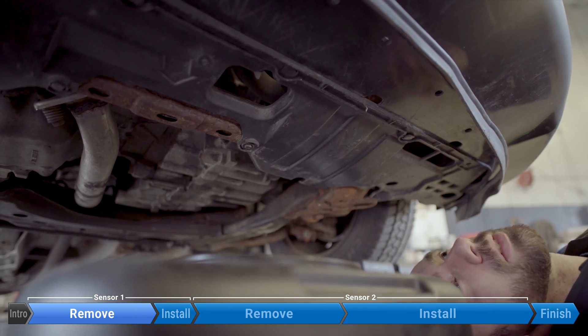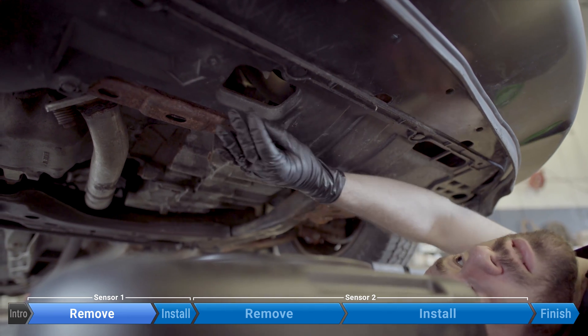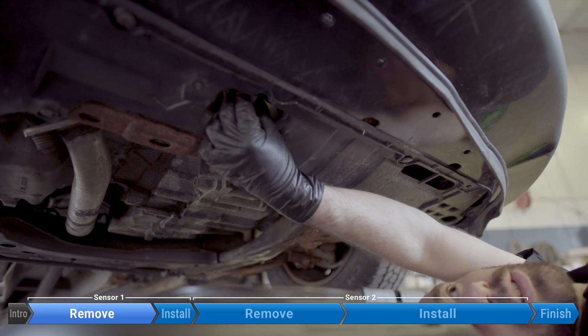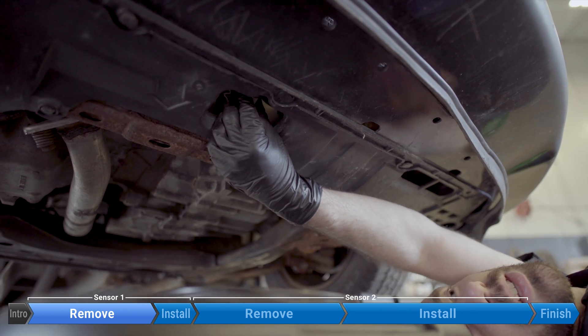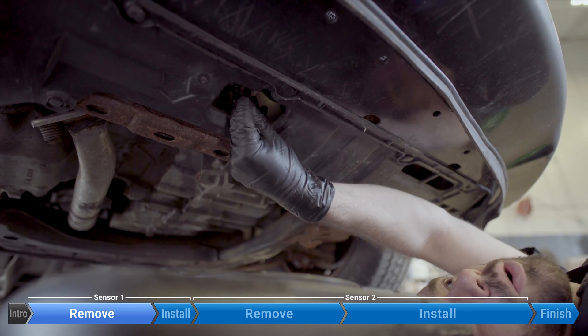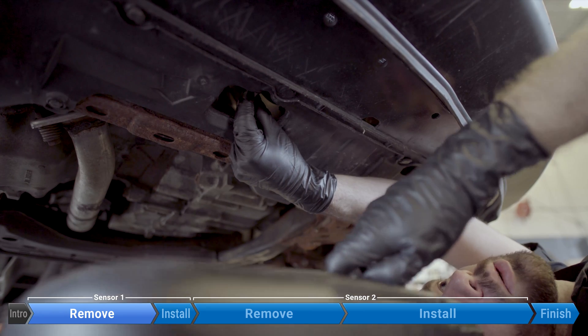We're under the car. You don't need to take the splash shield off to drain the coolant — there's a handy little access port right here. If you reach up inside, there's a little grey valve you can turn to open up the petcock. If it's a little tight, you can use a pair of pliers, but it shouldn't be that bad. So we'll just open that up, and once we do, the coolant's going to drain out right here, so we've got our drip tray ready.